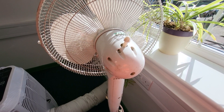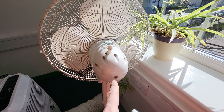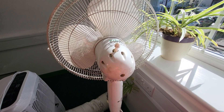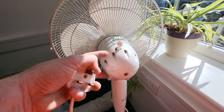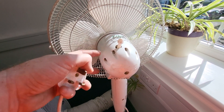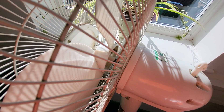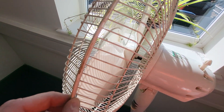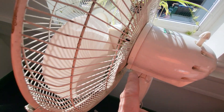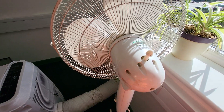You might think: if I'm getting a failure off of that, does that mean I can't pass it because I should be getting an earth off of that exposed metal? Well, what I find with a lot of these fans is that screw might be screwed into a piece of plastic housing, and then the plastic housing is separately screwed to the motor inside. You might be able to get an earth off of the metal rotator inside, but the metal casing is connected separately to the plastic housing. So you would think there's no chance of that becoming live if there was a fault inside. It's a real tricky one.